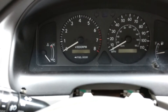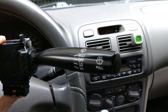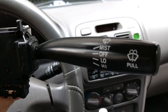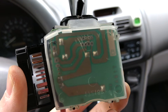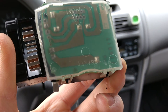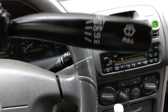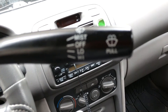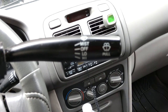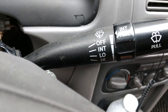Now you can see I have removed the fixed wiper stalk. It simply had a mist cycle, low, and high — and it was kind of annoying that there are no intermittent wipers, especially on those days where it's slightly raining or snowing. It's not hard enough to require the low setting because they'll just squeak and wear out your wipers. There's also a model with a basic intermittent stalk at a fixed four-second interval, but that also wouldn't be worth the money to upgrade to, in my opinion. So what I did was get this wiper stalk from a 1998 through 2002 Corolla.